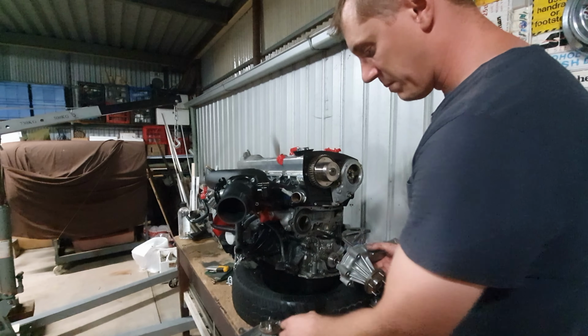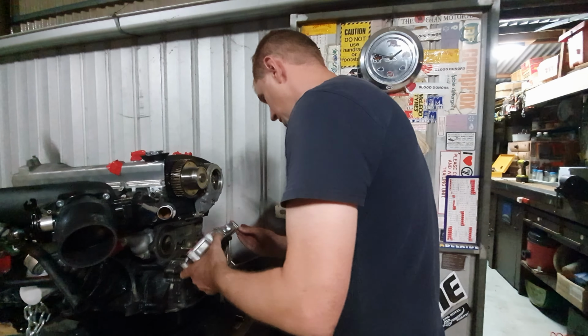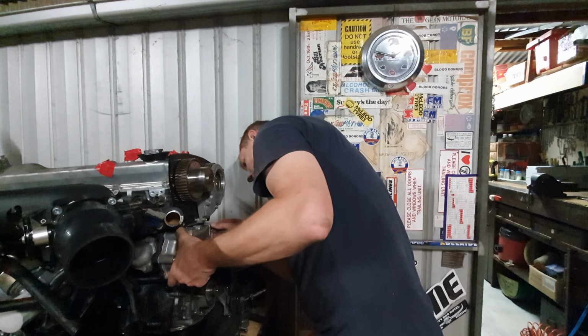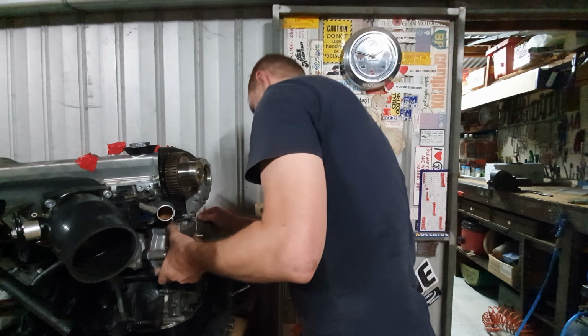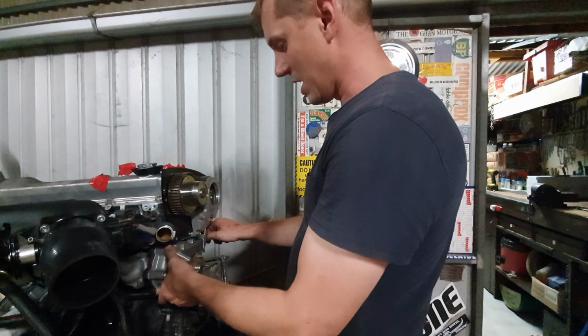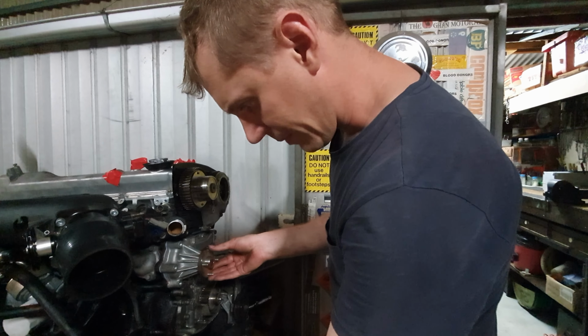There's the old water pump. The bearing feels a little bit rubbish. These are recommended to be changed about every 100,000 kilometers by Nissan. It's a part of the 100,000 kilometer genuine Nissan service kit, if you were interested in knowing how often these are changed. Now, these water pumps have come a long way, because when I was a kid, right,